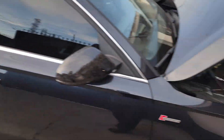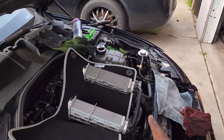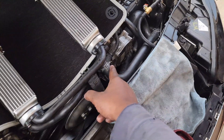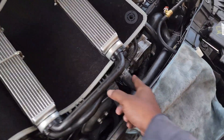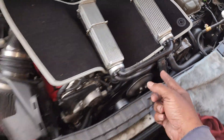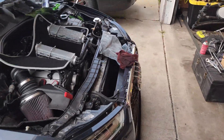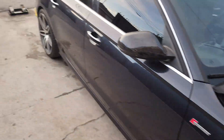Another way to test, like I said, is to put these in water with the same setup — get a heater hose grommet, put it on there, cap that end off, then put some air through one side with it submerged in water. I'd say probably no more than five or ten PSI and look for bubbles to come out.